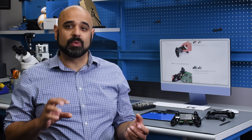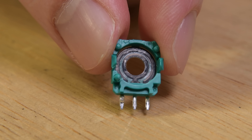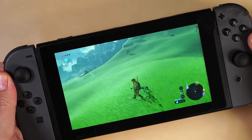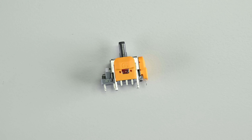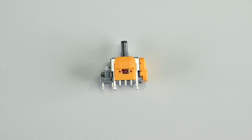If you've never heard of stick drift, you should count yourself lucky. Stick drift occurs when a couple of components inside your controller — the potentiometers — begin to wear and fail, and that causes the controller to register ghost input. Hall effect sticks like these are the obvious answer to this problem, but for some reason manufacturers refuse to use them.